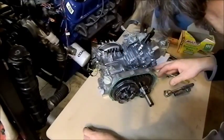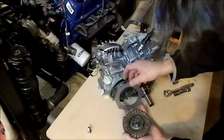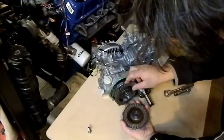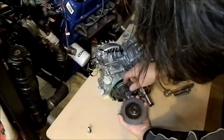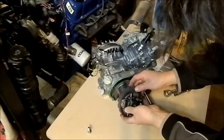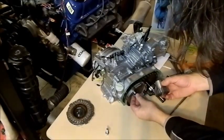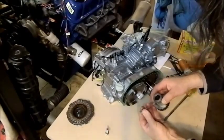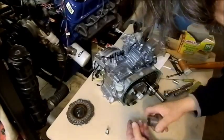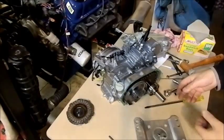Be very careful — there are a lot of parts in here, and again we have to bag and tag them. Here's our friction material — this is a lot like a motorbike clutch. We have our friction material, our clutch plate, and it's multi-plate like this. Automatic transmissions in cars use these sorts of clutches as well. They must always be kept in order. Here's the clutch hub, and you must not forget this little woodruff key — it fits in here and locks against the slot in the crankshaft so it can't rotate independently.